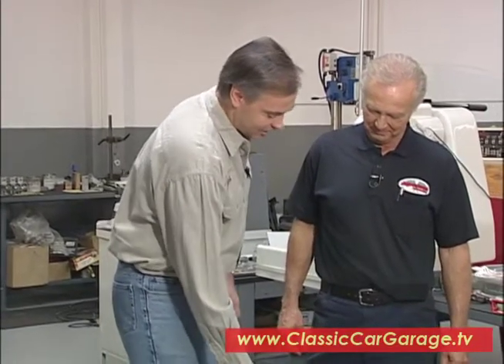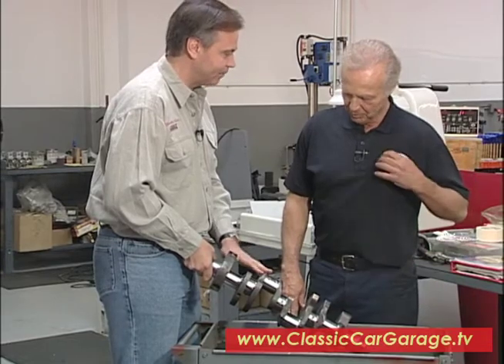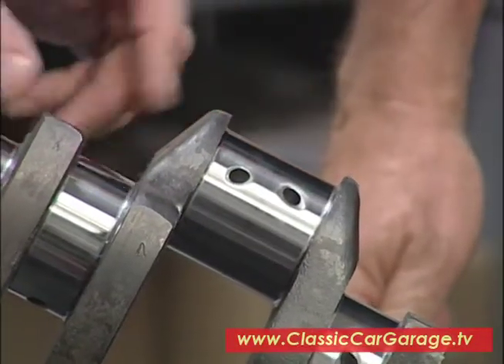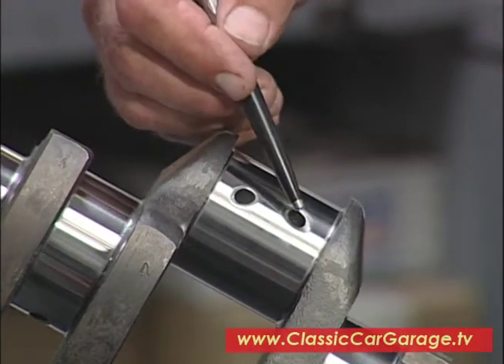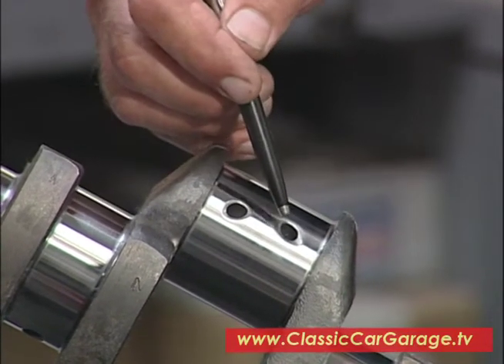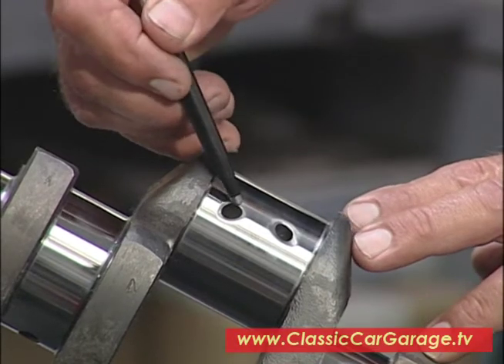Let's talk about the crankshaft here. This is a polished crankshaft. You actually send your cranks out to be turned, right? And what happens when a crankshaft is turned? We take a standard crankshaft and we'll have it cut 10-10 on the split. Being on the split means that you have a high dimension and a low dimension — we go right in the center of that dimension. That'll give me what I need in this shop: 2.2 to 2.4 thousandths clearance, bearing clearance. Then, once it comes back to you, you polish it, but you also add your own element to it. Tell us about these holes.